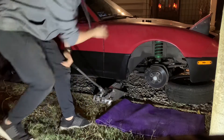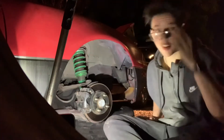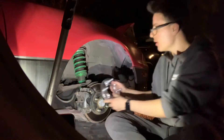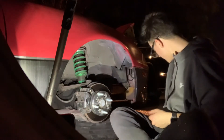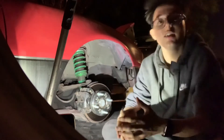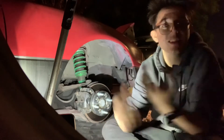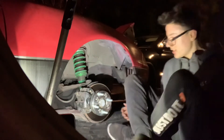You always want to give the car a nice good push whenever you jack it up, so when you go underneath it, it doesn't scare you. Give everything a nice good shake before you get underneath the car — make sure it's not going to fall. Now, before I put spacers on, I take a Scotch-Brite pad and wipe down the OEM bolts, lugs — anything that mates together. I wipe it down with brake cleaner, paper towels, or a Scotch-Brite pad if there's bad rust. It's preventative maintenance.